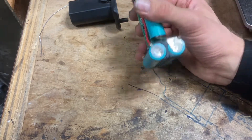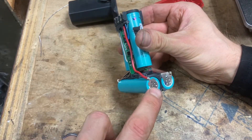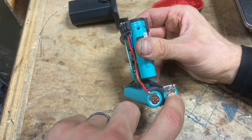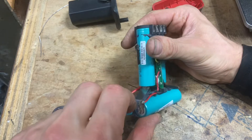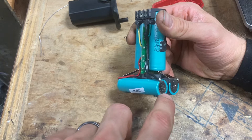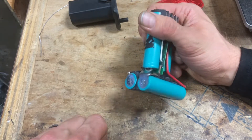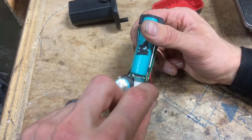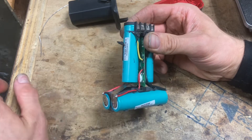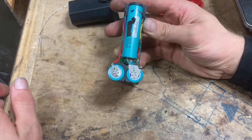So what do we have here? We've got a red wire going right here, and a solid contact that goes from the bottom of the cell right here. We've got a black wire going right here, with a solid contact right here. As I do this rebuild I believe I can keep this brown wire connected here and this red wire connected here without having to re-solder later. I'm actually going to reuse these tabs because they're perfectly made at the right angles with the right bends.